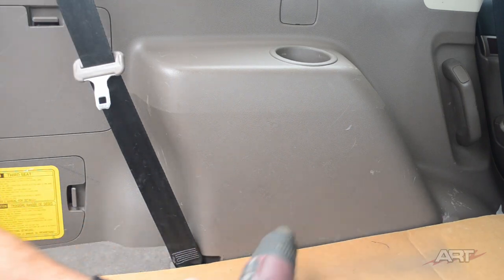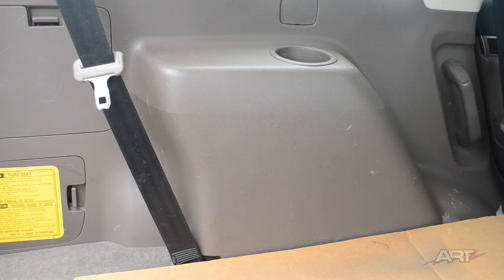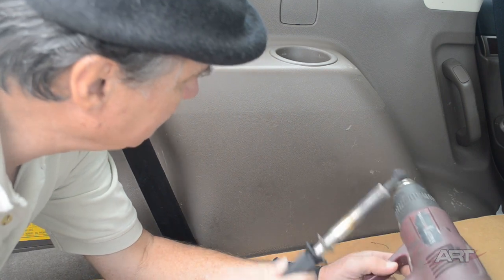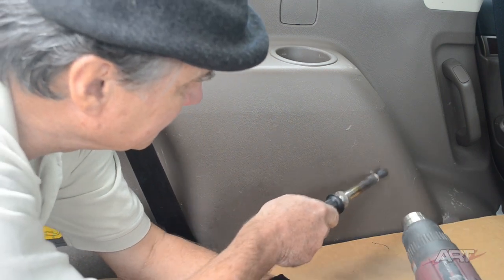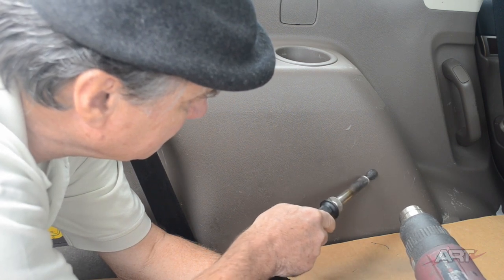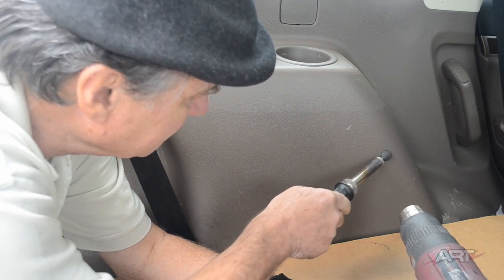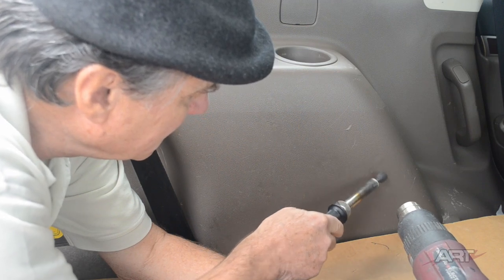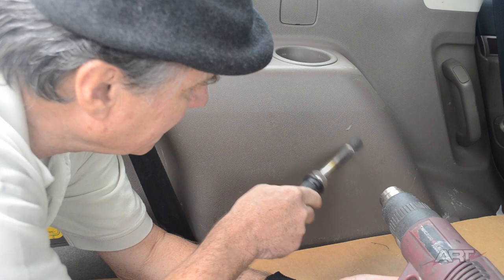So when the polypropylene gets scratched, it imparts hundreds of tiny cracks which make it look white in appearance. But as we heat it up and melt it together, we restore the original color. And restoring the original color goes a long way towards completing our repairs.